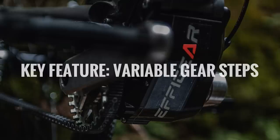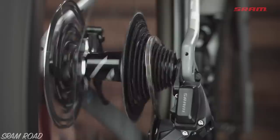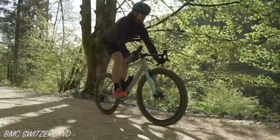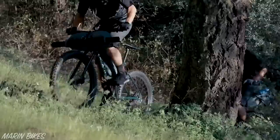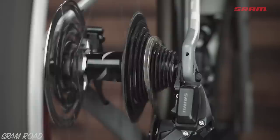Okay, now that I've got you stoked on gearboxes, let's discuss the features unique to the Effigear Mimic. Gear steps are the percentage difference in gear ratio when you change your gears. A bike with smaller gear steps is particularly nice at higher speeds, as you can better fine-tune your gear ratios to achieve the cadence or crank revolutions per minute that you're most comfortable riding. Smaller gear steps are much less necessary at lower speeds, as your speed changes very little for each shift. To squeeze the most out of any gear range, a drivetrain ideally starts with big gear steps in the easiest gears and ends with small gear steps in the harder gears.